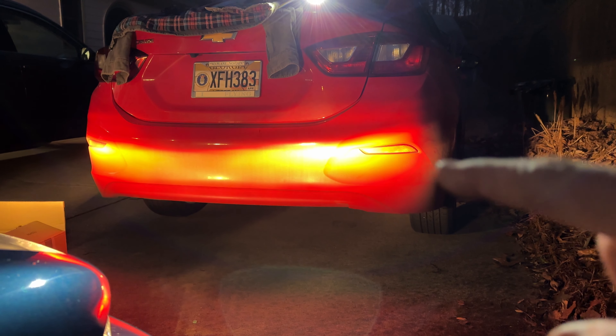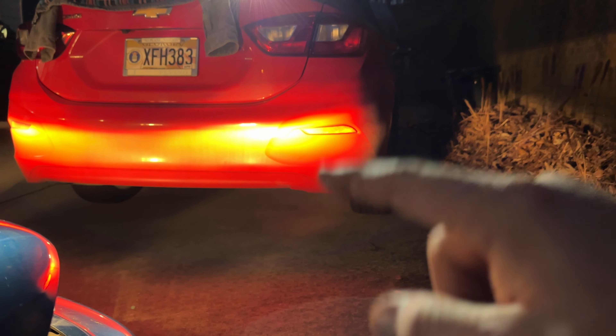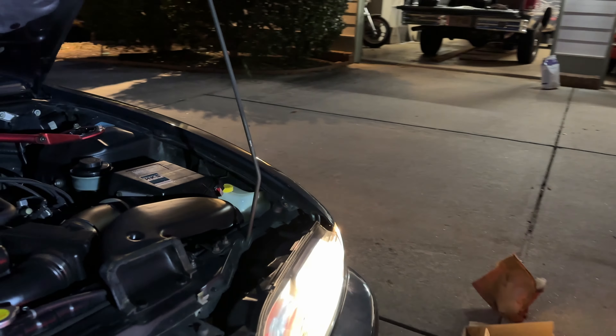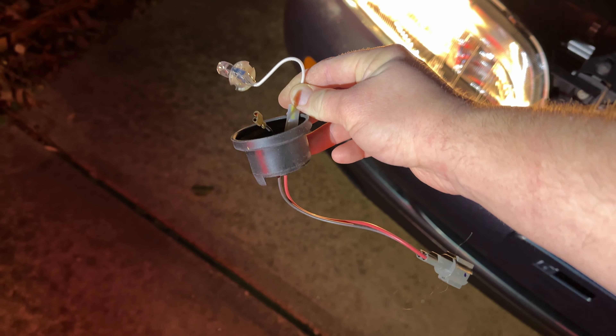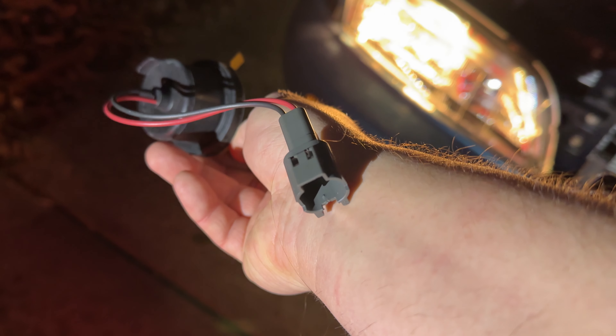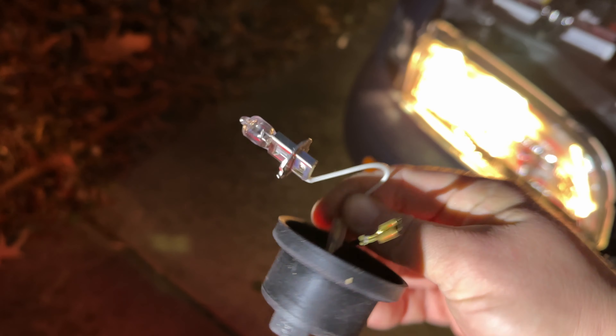Quick update: I plugged the lights in to test them and the visual output looks about the same. I haven't even leveled the lights yet, so I might not need to. You can tell the cutoff is higher on the right side, which is exactly what I wanted — that's the dominant side for seeing along the right-hand side of the road. I did have to do the same bright light connector swap on this set. You just pry off the plug from the front using a pick tool, disconnect the ground on the headlight, and swap the bulb — easy.